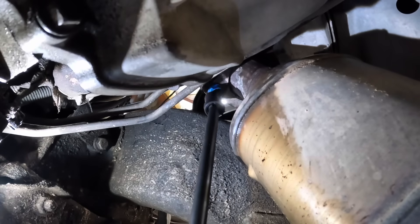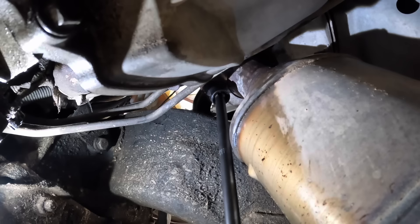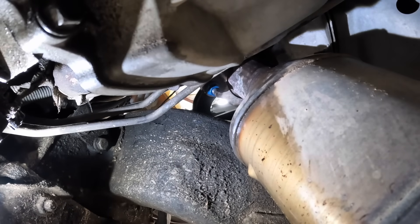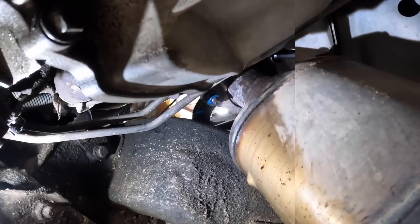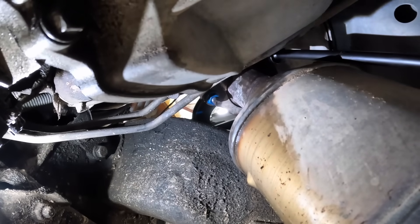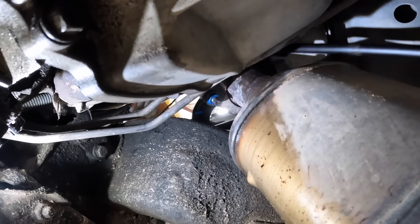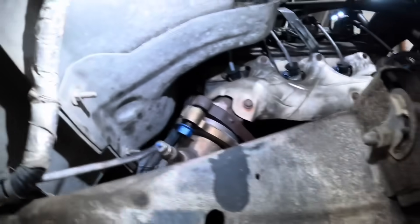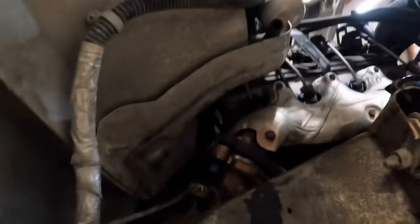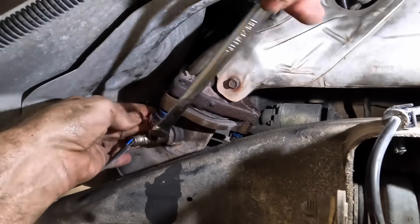Now that I know what I'm doing, we're going to get through this. That one's on, good. Let's get that one in the top — I can't reach that one, need a longer extension. I got a socket on it. Loud noises coming in. Clickages. And then that third one — we got to get that one from the outside. Remember, the O2 sensor's in the way. Quick ratchet wrench gravity action. And that's the last of the exhaust nuts.